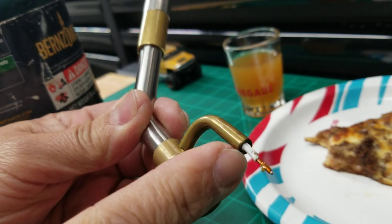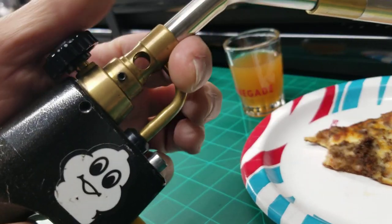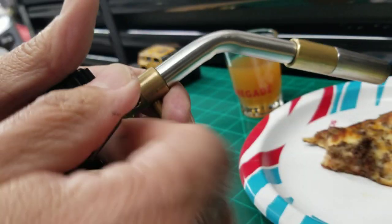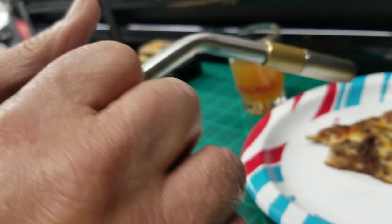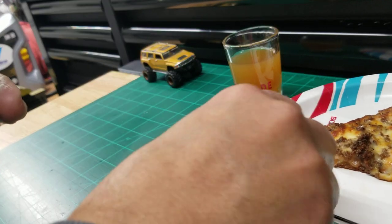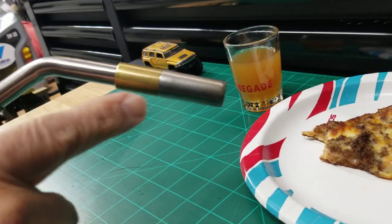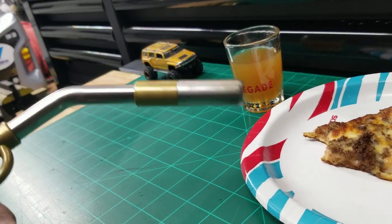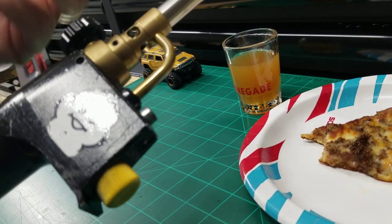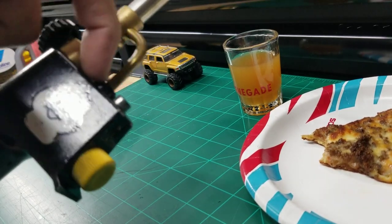So once I put the insulation on this and stuck it back in here, got that on there, put my set screw back in if I can find a hole. All right, set the hole on there, line it up, make sure it's tight. And now, God dang it, that's not good. All right, and then go, voila, the spark travels up the tube, out the end, lights the flame, blah, blah, blah, and that's how it works. So simple fix. When these things just go click, click, click, and then they don't come on, check your igniter wire, and that's probably the fastest and easiest fix.